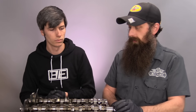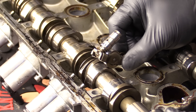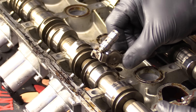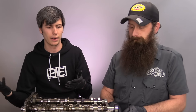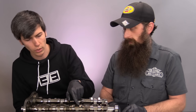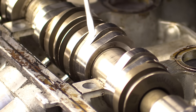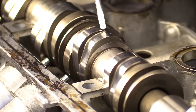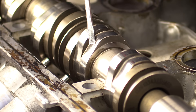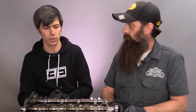This will also improve throttle response and makes for a pretty fun car to drive. And just because this engine doesn't have variable valve lift on the intake side doesn't mean you couldn't do that — you could have two different cam profiles on the intake side to get more air in at higher RPM and higher loads. You can also change the duration with the two cam lobes. It's not just lift — we're also opening the valve sooner and closing it a little bit later, so the duration is actually longer as well.